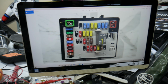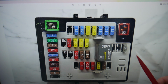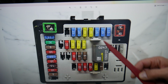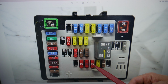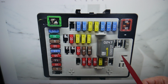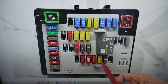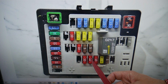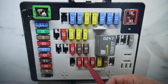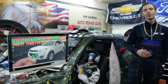So guys, here, let's explain which fuse we need to check for the dash screen display. Fuse numbers are a little bit confusing. They go like that, 1, 2, 3, then 4, 5, and they alternate: 6, 7, 8, 9, 10, 11, right? And then you need to check one fuse. That's fuse number 15. You see that fuse, that's the one you will need to check. What about a relay? You don't have a relay, you have only that fuse, that's known as a relay fuse.